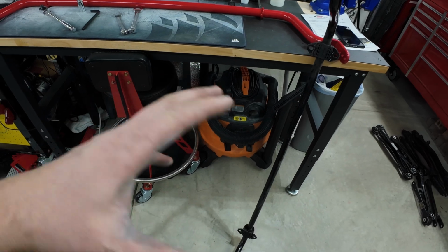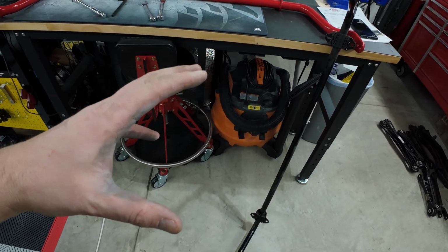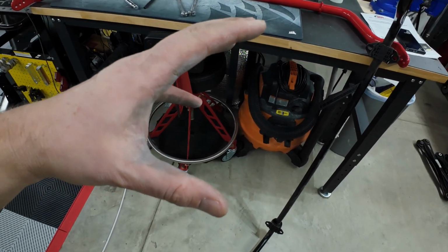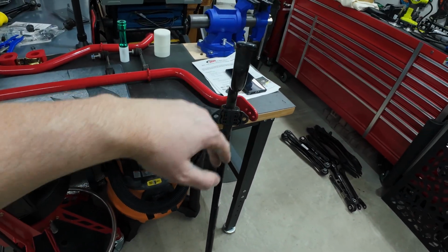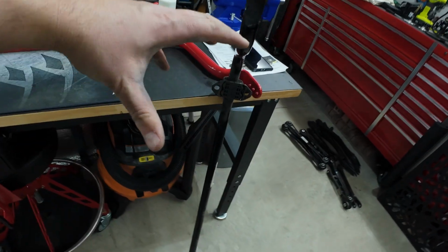You're gonna need to, out of breath, but I went out the passenger side. It would be the opposite if you go out the driver's side, I guess, but I ended up removing the bushing off of the long exhaust mount from my exhaust on the driver's side. That let me then swing this down up above it, and then I was able to get more further inward. You just got to kind of rotate her around.